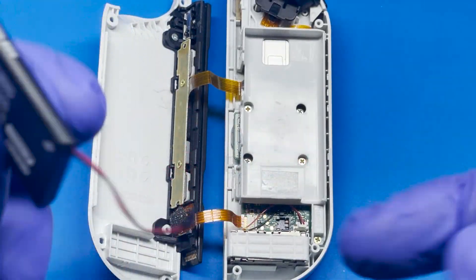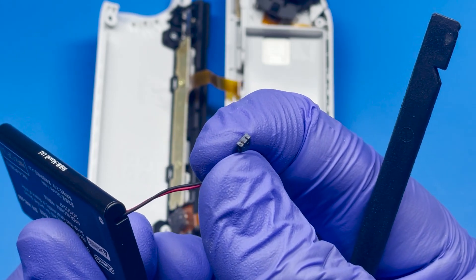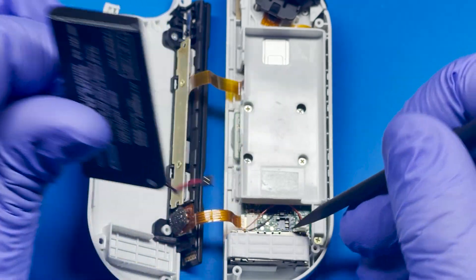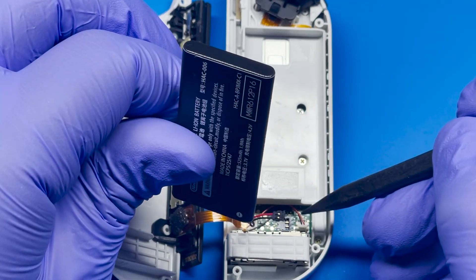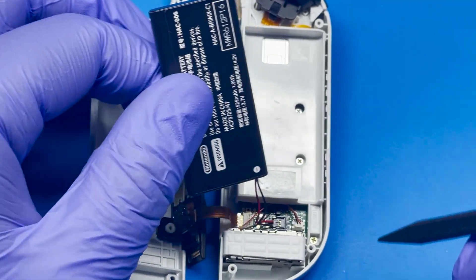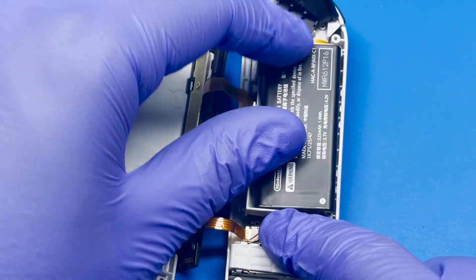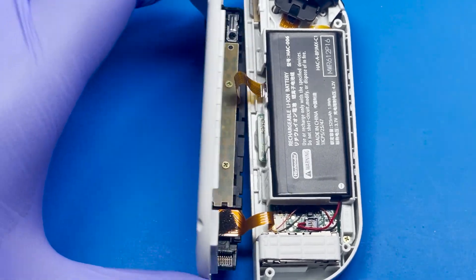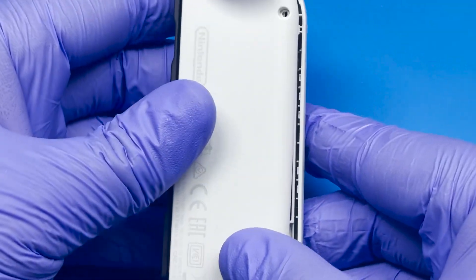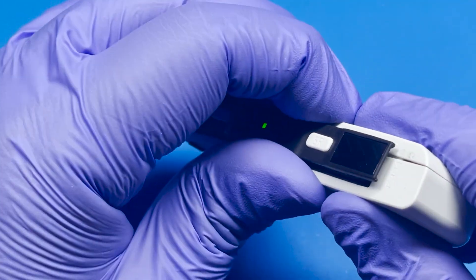Let's put the battery back. You want to make sure that the two cutouts located in the bottom — you can see that here — are going to be pressed up against those two metal prongs located right there. It's pretty straightforward. Put some pressure and that should secure. You can see that's on there nicely. Wrap this around and then simply put the battery back on. Once everything's on there, we can close the Joy-Con controller and put the remaining screws, and everything should be fine after this.